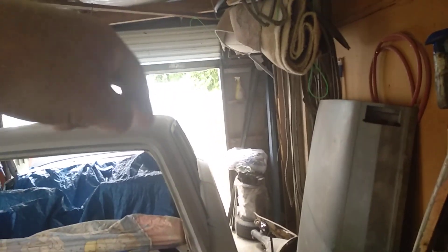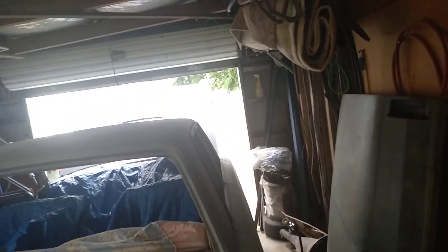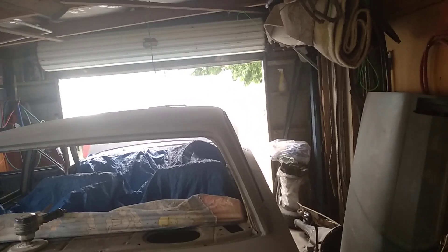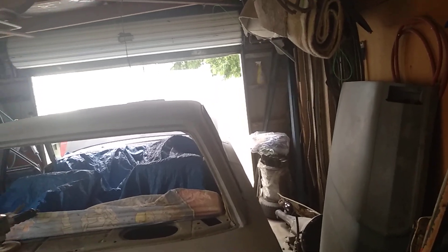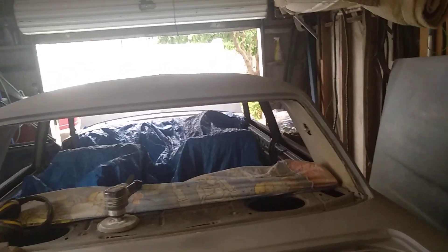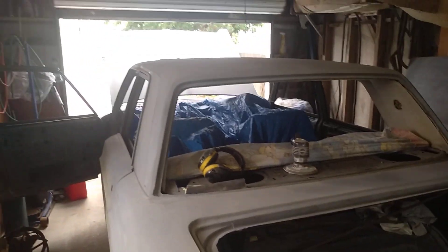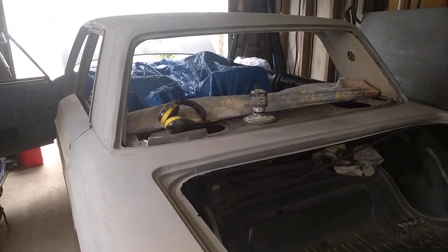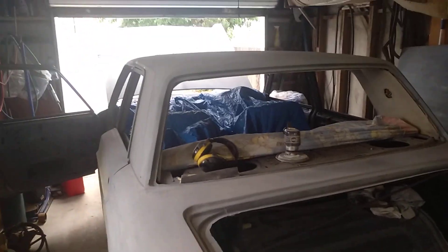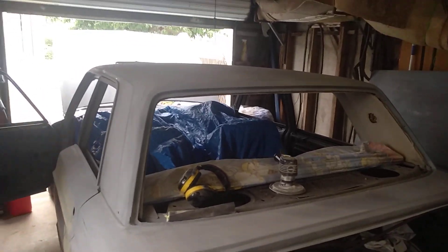I might put a little bit more body filler down the side of the roof as well, because I haven't 100% finished that - where it was sort of dented and messed around with down there. I'll sort of do the worst of that and try to get the roof reasonably cleaned up, so at least if they smash a few coats of primer on later, they can block it back and it should be reasonable. They might have to put a little bit more body filler in, who knows. But I'll get it reasonable. I'll do the same with this - that'll do for the meantime. I'll just give you a bit of an update because I'm bored. Cheers.